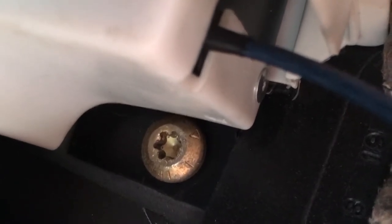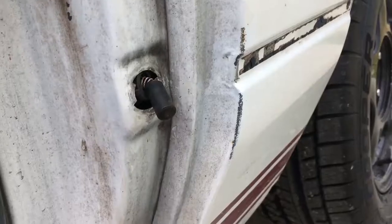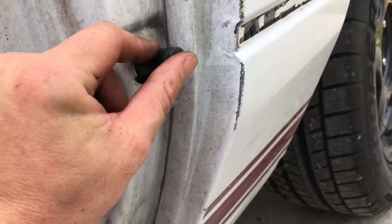I took all the bolts out for this little metal deal - where your headliner gets stuffed in - and now we can peel this piece of trim back. I can see where the recoiler is. Let's see if I can pull this thing back - there we go. You can see that gold Torx head; we're going to take that out and then I can take the recoil unit out.